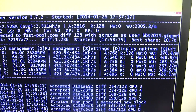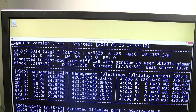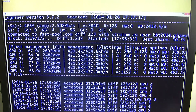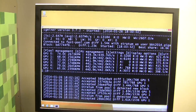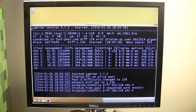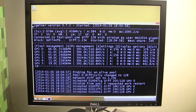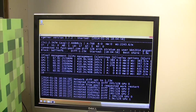All six cards were shown running. We stair-stepped the hash rates — first just verifying all six cards initialized, running around 409 to 417. After a few setting tweaks, we got them stabilized at 430 to 445, which is about the target for these 270s. Some cards are great runners and we're getting 465 to 470 out of them. We'll keep tuning this one to hit that range — making it a really solid 2.6 to 2.7 megahash box. Good thermals, good price, solid hasher — bar none one of the best bargain boxes you can build.